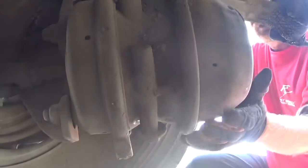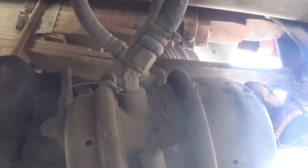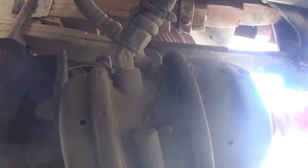All right, we're going to check these chambers the same way as we did up front: not cracked, bent, broken, illegally re-welded, and no hissing indicating a leak. We have our high pressure air hose here that we're also checking, just like up at front, and all of our hoses. We're going to make sure it's properly connected at both ends, free from any abrasions, cuts, or tears. Also, no hissing indicating a leak.